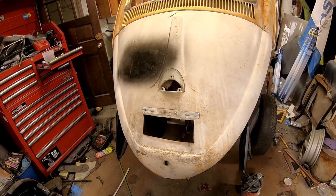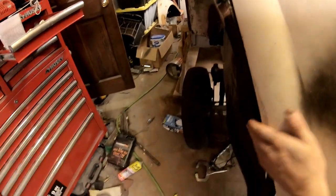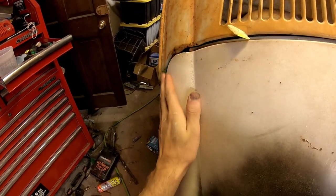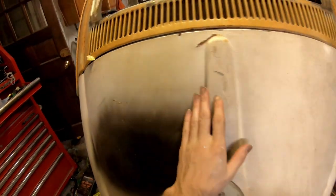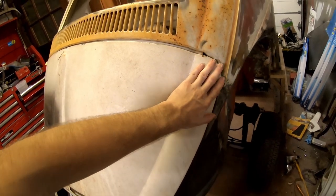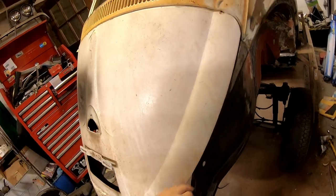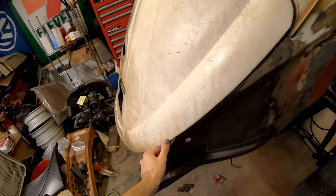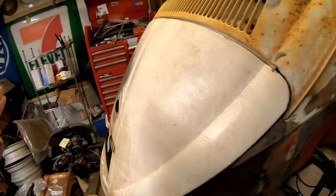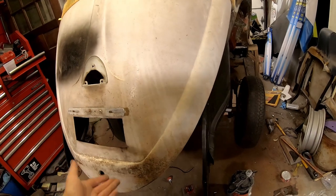What you didn't see is I have fit the engine lid now. And on this side, fits pretty good. Gap is quite wide at the top, but this lines up. Body line lines up. Come across over here. Whoa, paint can. Body line lines up, sticks a little high, gaps wide again. Doesn't quite line up. Now, I think that's just the rear end can get pulled over. This can get adjusted. But the point of putting that on was now I can fit the rear apron.